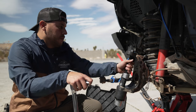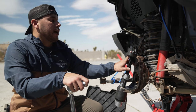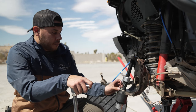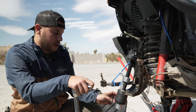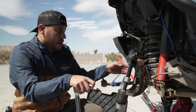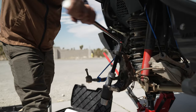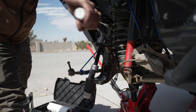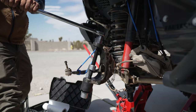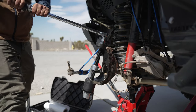When you're removing your ball joints, you want to do the top one first. The reason is that the rod that comes with the ball joint removal kit has to actually go through the hole where the top ball joint used to exist. Exact same setup — cup on the bottom surrounding the entirety of the ball joint, all corners making contact with the axle itself, nothing making contact with the ball joint. I'm just going to use a torque wrench and apply slow, steady torque.